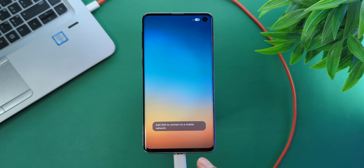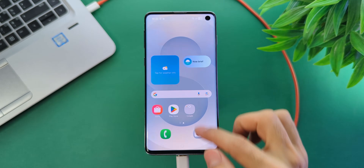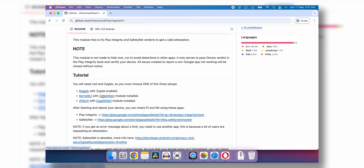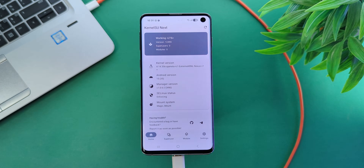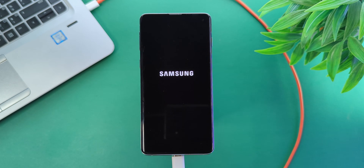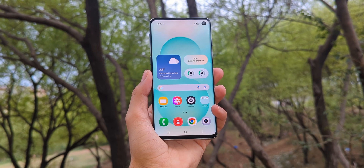Go through the setup steps and skip what you don't need. After that, check the model — it'll show you you're using the Galaxy S25 Ultra. Now sign in with your Gmail account and start checking out the new features. One thing to note though: when you go to the Play Store, it will probably say device not verified — that's normal on custom ROMs. To fix it, download Play Integrity Fix and Zygisk from the links in the description and flash them using the KernelSU Next app. Go to Modules, Install, and select both files one by one. Then go to Settings, Apps, and clear storage data for Google Play Store and Google Play Services. Reboot the phone — once it's back on, go to Play Store and now it'll say device is verified. This matters because if your phone isn't Play Protect certified, it might not get Android updates, Google app updates, or even run some apps correctly.